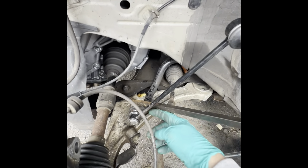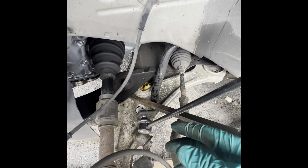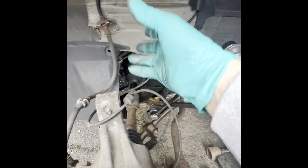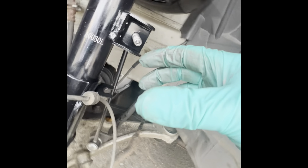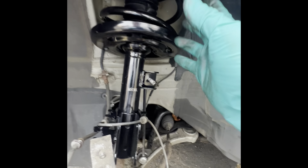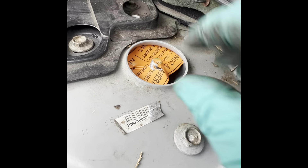You can avoid all that by just removing the sway bar from the bottom and from the top and removing the sway bar out, then work on the strut. The installation process went in just the way I described: with this part facing this way, put it in, line it up in the hole and work it up and over. Then once you're up here, line up the bolts, move it around until you can see the thread holes on top, insert the bolts, and line them up to exactly where they were marked.